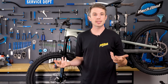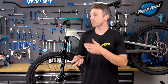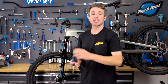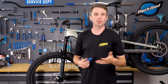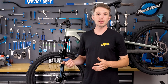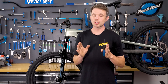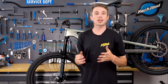You don't want to go too far with this, bringing the pistons out so far that they're always rubbing or giving you a really strong feel that's immediately at the bite point, because quite simply it's not really going to last and you're going to get quite an inconsistent braking feel even through the course of a ride. Not only that, but you can also add elements of rubbing from the rotor. If your rotor is really bent it can have a detrimental effect on performance, but this can be a great way just to tweak the caliper to allow for a reasonably true rotor to run its course. If your rotor does have a slight tweak, by all means try and bend it back, but be gentle — much in the same way we're making small adjustments to these pistons, you want to be making a small adjustment to the rotor.